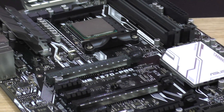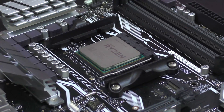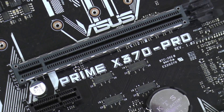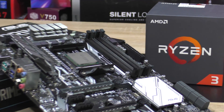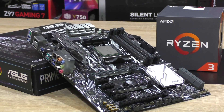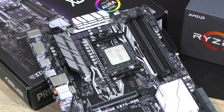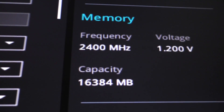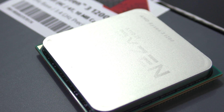Since I don't have the usual motherboard one would want to pair this AMD Ryzen 3 processor with, I'll go with an X370 chipset board I used for Ryzen 5 and 7 testing. This is the Asus Prime X370 Pro, but normally you'd go for a B350 board instead, to not waste money since a Ryzen 3 build probably would end up being a budget build for most of us. As for memory, to keep the configuration as real as possible I'll not go for 3200MHz, but will downclock my RAM to 2400MHz instead. At stock the CPU is clocked at 3.1GHz base and 3.4GHz turbo.